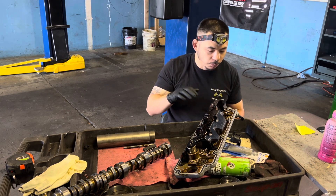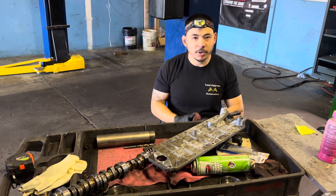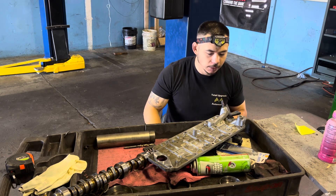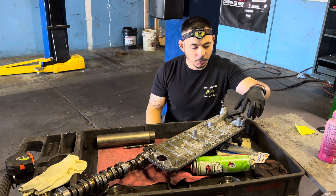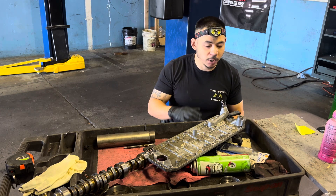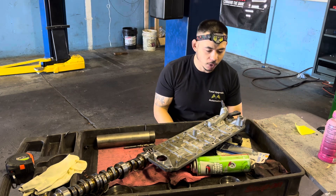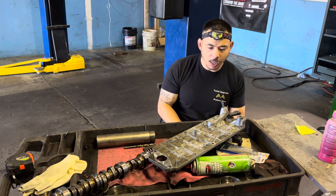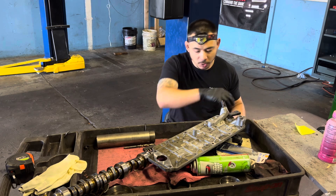This manifold was the culprit. We fixed everything, took it for a test drive, customer picks it up and it's misfiring. There's also a filter right here you need to check — make sure it's free of debris. But if you replace the whole assembly it will come with a new filter, so you don't have to worry about that. Like I said, if we did this job again we'd replace this manifold every single time along with the lifters and head gaskets.